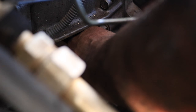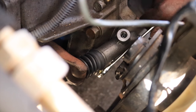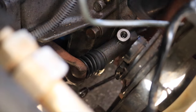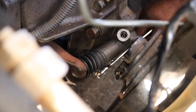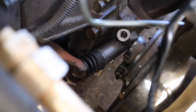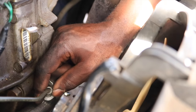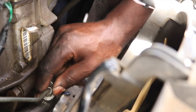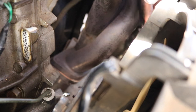I hope this thing gets tight. The last bolt I pulled from my stash — I always keep all the bolts, you never know which one is going to help you. There we go, all the way bolted on. We gotta put that line back on. When you tighten this thing, make sure you've got it just right or it's gonna cross-thread. It should just spin all the way on. If you're having trouble spinning it, it's probably cross-threaded. So don't keep tightening it — make sure it's on right.